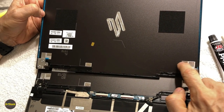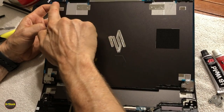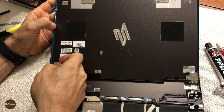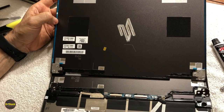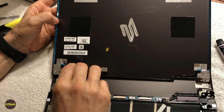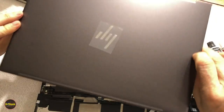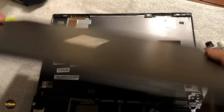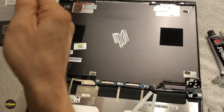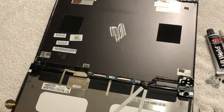And you can see these small pieces of blue tape here, along the edges, along the top. These are the glue strips that help hold it to the LCD screen. And when you have it all in place, you'll pull the one down here, and that'll help hold this ground strap against this unanodized portion of the aluminum cover. So that's the cover piece. And when you're all done, of course, you can pull the little protective cover off the HP logo. It's been burnished into the aluminum. So there's the cover. We'll put that on last. The next part number to take note of is for the LCD.